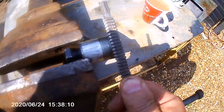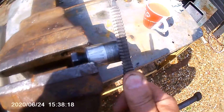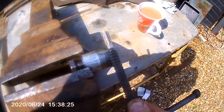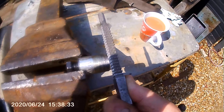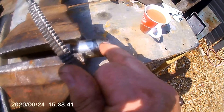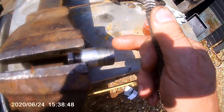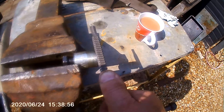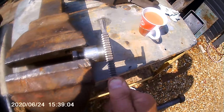It appears you're not doing anything - you don't see loads of metal filings coming off - and sometimes you think it's not doing anything. But you'd be surprised. You can use one of these thread files for all sorts of things. It's one of those tools that you think you never use, but I've had this one 40 years and it's pulled me out of the mire more times than I care to remember. If a thread's been cross-threaded, you get onto a good part, file it, and work on to the bad part - it pushes the thread back into position.